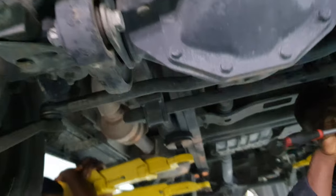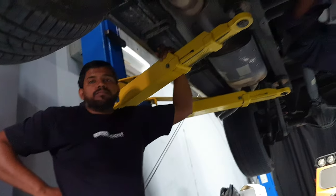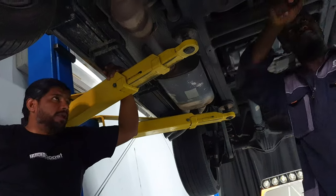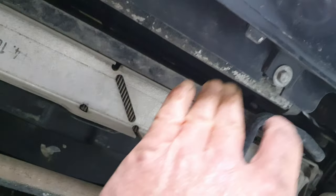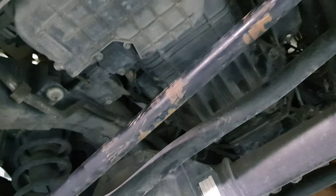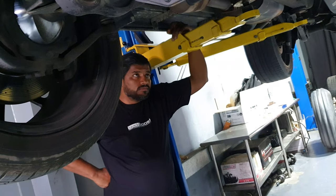All right, you need to say something about this. Did you make a health report? Yes. So what do we have up to now? It looks like the radiator is leaking. We have to make a leak test. The coolant expansion tank, if you pressurize it, it might start leaking from everywhere, or it might crack because it's bent.